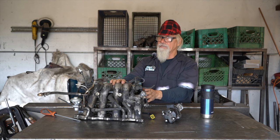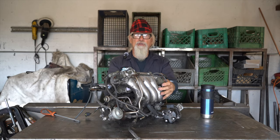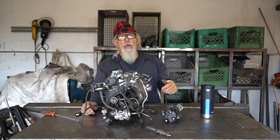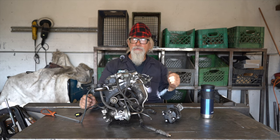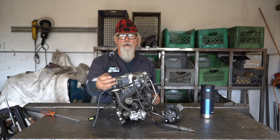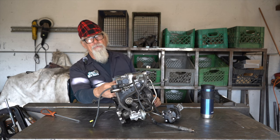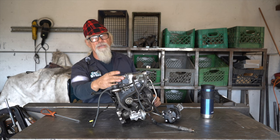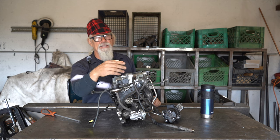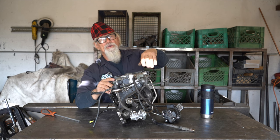Let's get some basic facts. When you've got an issue where you're trying to maintain 25 miles per hour in gear - whether automatic or manual - and the car is surging, speeding up and slowing down, this is going to be a TPS. The TPS is located on the back of what's called the throttle body, which has the butterfly in it. When you're doing your TPS, don't take the TPS off - it's got white glue on it. You're going to see some still pictures with close-ups as usual.